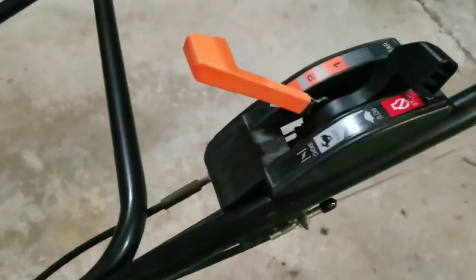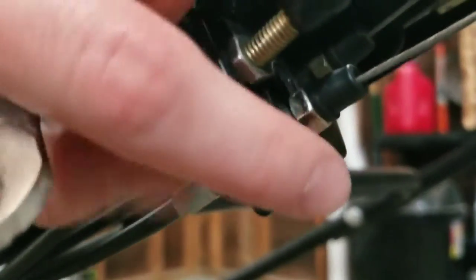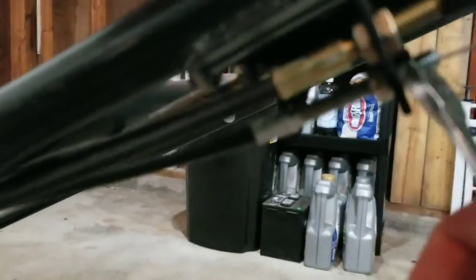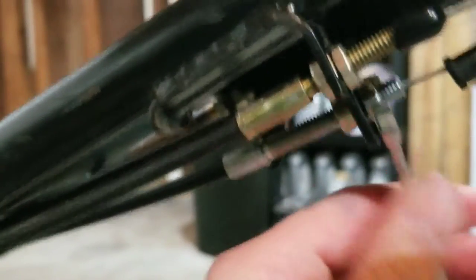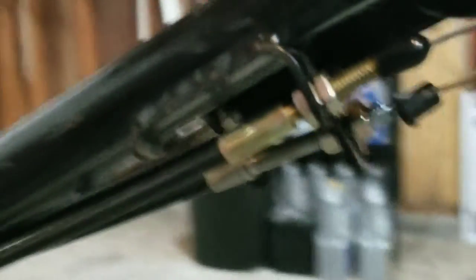So for the self-propelled now, it's pretty easy. There's a nut on each side — you just loosen this up a little bit and see how it's holding it in place with this bracket here. Basically it's clamped in between this metal bracket right here. There's a nut on each side, and essentially what's happening when you're trying to adjust it — this little rubber grommet pulls off here and you can see it's threaded onto this nut here, keeping it in place. This is a 3/8" open-ended wrench and I believe you can also use 10 millimeter, but it just depends on the model. If I move the nut down by backing this one off it'll loosen it up. If I want to make this cable tighter so it engages better, I'm gonna spin this nut the other direction.